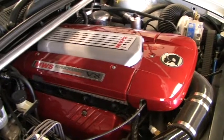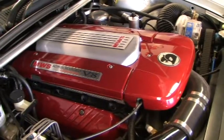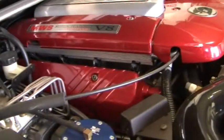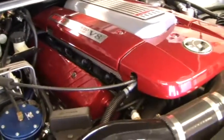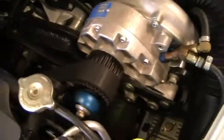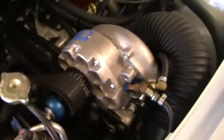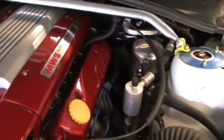Other features under the bonnet: there is essentially another fuel line that goes in — there is one at the front, one at the rear — so essentially we have twin feeds to the fuel lines once we start to make higher horsepower. You can obviously see the intercooler pipework that goes in through here, the T-trim supercharger, a crank support for the nose of the engine — all the bits and pieces to essentially turn this thing into making the highest 600 rear wheel horsepower, which is the horsepower this car is making.